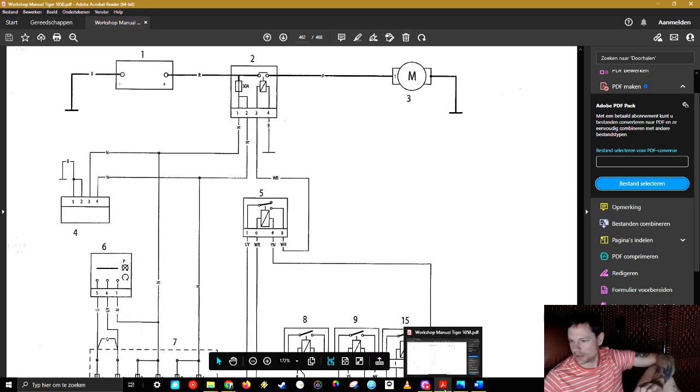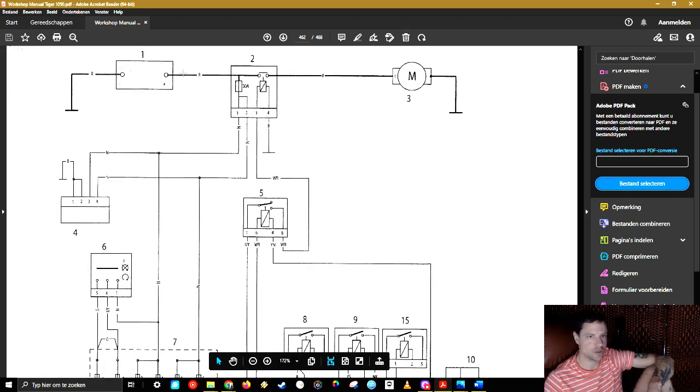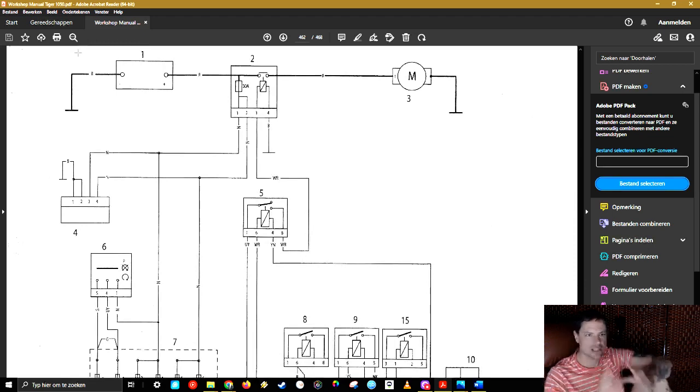Let's see if there's something else I need to address. If you look at the battery itself, it has two major functions. The first and biggest one is starting — that's why they call it a starter battery. The power comes from the alternator, gets directed by the regulator. The battery also acts like a reservoir of electricity when the system is in need and the regulator can't follow up — the system will draw from the battery.